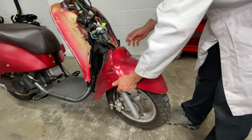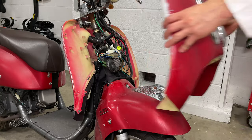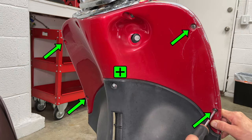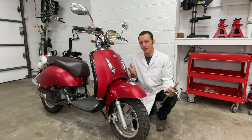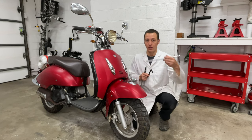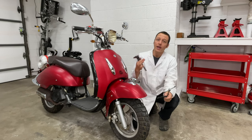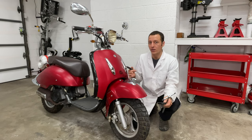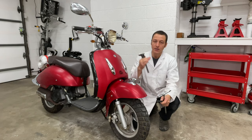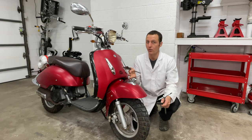I'm all done here. Remember to route the brake hose through the slot in the fender and tighten all three bolts. Finish assembling the body fairings with as many screws or as much duct tape as needed. Replacing fork seals is a medium difficulty level, so if you're good at fixing stuff this should not be a problem. You will need a long 10mm allen key and a fat 12mm allen key to do this job. Keep in mind, measuring the fork seals is perhaps the most important step — fork seals come in many different sizes, sometimes just one millimeter apart from each other, so you must get an accurate measurement in order to get the right seals.